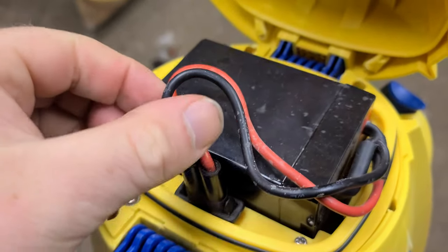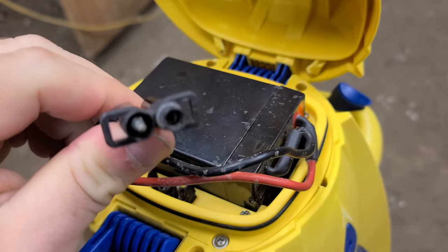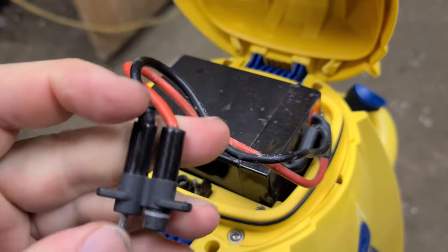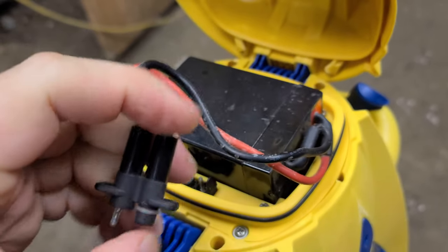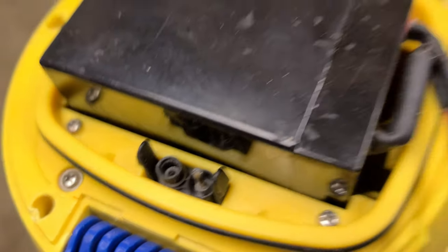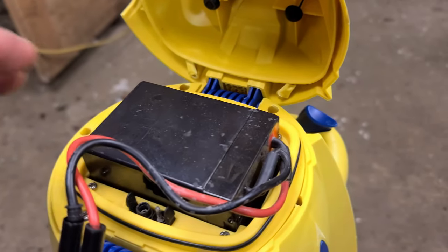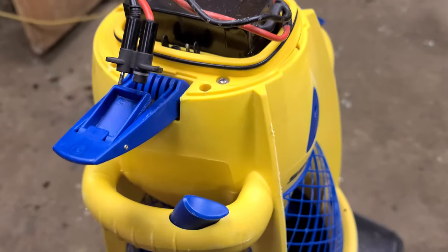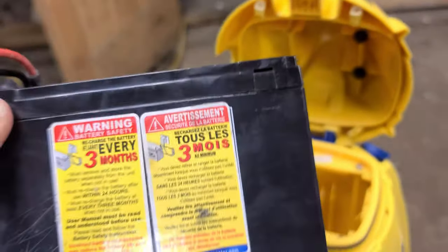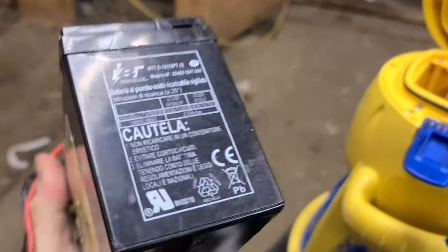Pull the nose off and there's your battery — it's just a typical lead acid battery. This is the connection that SeaDoo, or whoever makes this thing, has come up with. This is your ground connection and this here is your positive connection, and they plug into that plug right there. This battery is totally dead — you can tell just by the age of the thing that it's going to need a new battery. Pull this out and there it is — there's again your warning sticker to charge this battery every three months. Obviously they don't have a lot of faith in them.